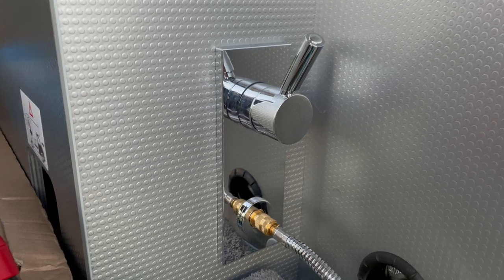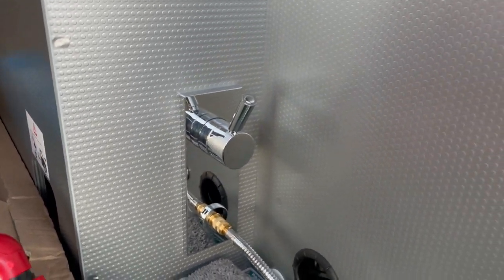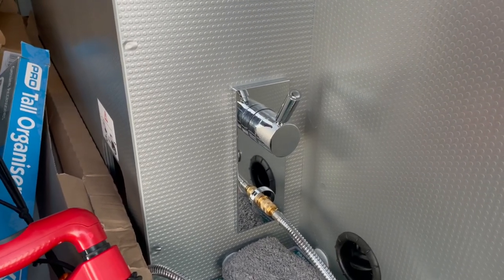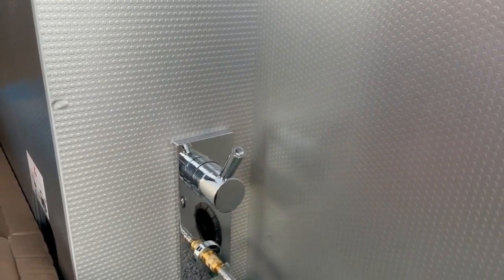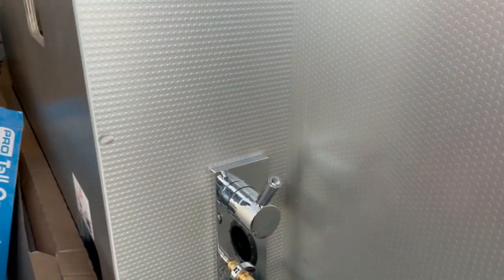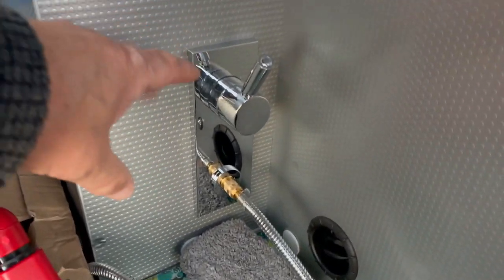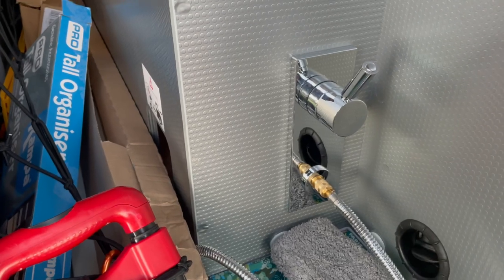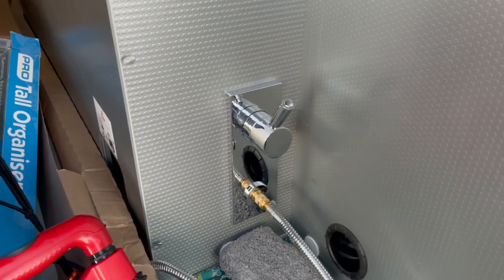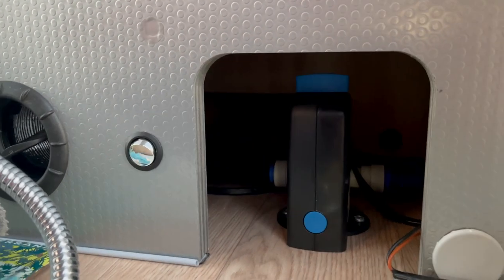One other thing when draining down: don't forget to drain the external shower. After you've drained everything off, just operate the shower so any water stuck at the back in the pipes around here is pumped out and forced out. If a little bit of water is left behind it can freeze and split the pipes. That's just another little tip — I know I personally always forget to do that. I hope you find this really useful.